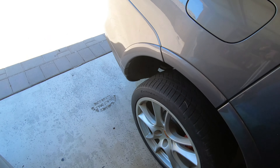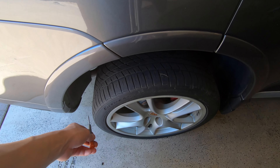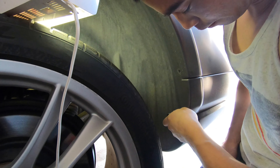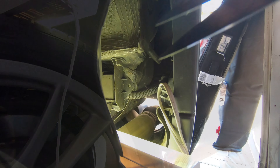Moving to the back of the vehicle, we have a drain port on each side. You're going to have to peel back the fender liner over here. Start by removing a few T25 screws to get access to the drain port. Now we can see the rear drain — it's the same situation as the other ones. The tip is pinched off, so take a pair of scissors, snip the tip off, and this is going to give it a bigger opening and prevent it from getting clogged.